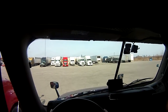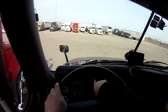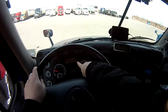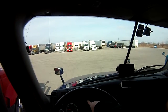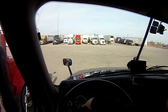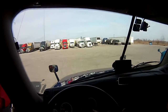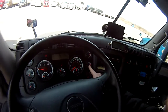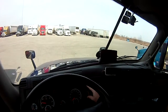From there go into your gauges to find your voltmeter. On the 2016 Cascadia Evolution the voltmeter is in here — hit the plus a couple of times to get to it. There it is — battery showing how many volts. My alternator is charging between 13 and 14 volts. Water temperature building to normal operating range. Oil pressure rising to normal operating range. Primary and secondary air gauges building to governor cutout of 120 to 125 psi.